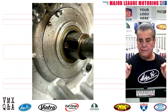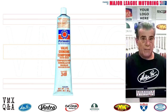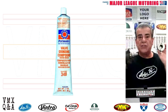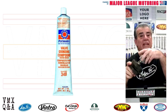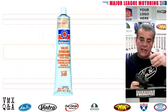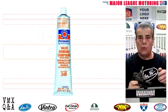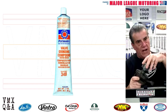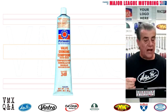Here's how you can rectify that problem if you have a burr: valve grinding compound. You can buy that at any auto parts store. This is what the end of your crank looks like sticking out of your engine, and this is going to be your rotor. Put the valve grinding compound right where that rotor sits on the crank and begin to spin it — you can spin it in both directions, but start off going in one direction. Then take it off, examine it, and you should see a nice matte finish, uniform all the way around. If it doesn't look uniform, put a little more valve grinding compound on there and start spinning it the other way — right to left, left to right.